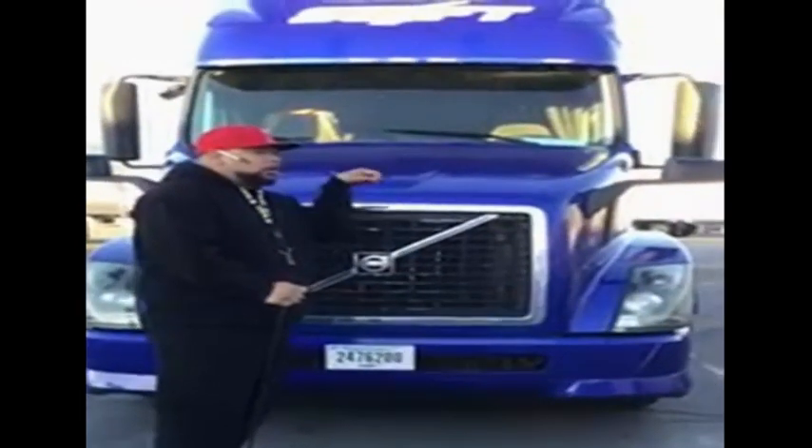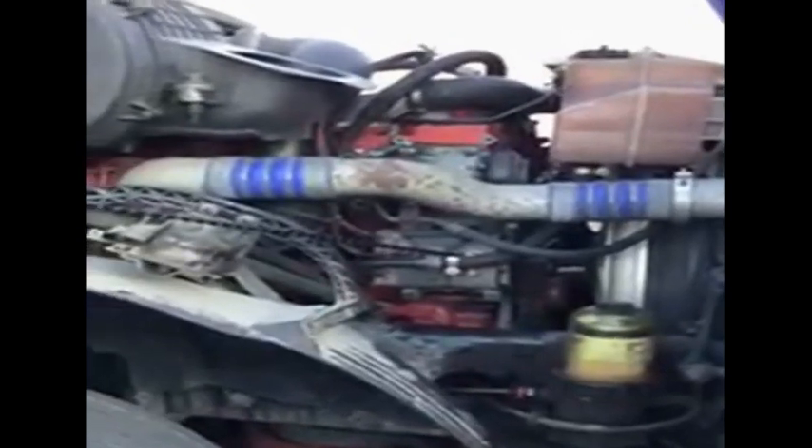Then you open up the hood. Coming to the passenger side, on a Volvo during your test there are three things we expect. First is the alternator — you'll always find it because of the red tag on it. Second is the belt — you push on it, don't pull it. When you push, you want no more than three-quarters of an inch of play. The last thing to inspect on the passenger side is the water pump — find the fattest hose and chase it.